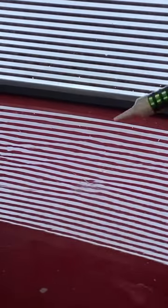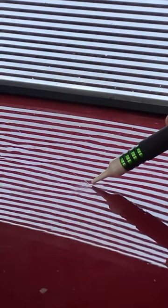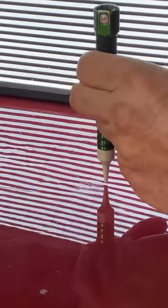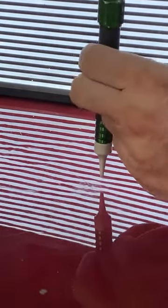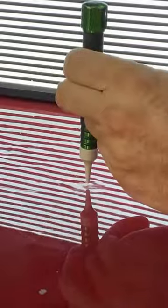All right. So in the real world, I'm going to change my board. I'm going to zoom in just a little bit, and I'm going to tap down right here. I'm going to tap down right there. And then there's still a low here and here, right there. Another thing I like to do is, if this dent doesn't want to cooperate, I'll just open it up again. That is PDR 101.